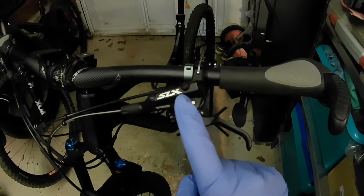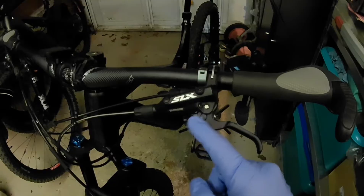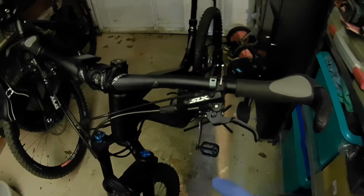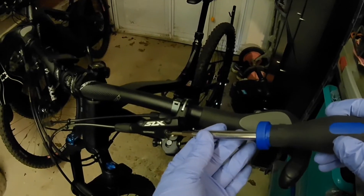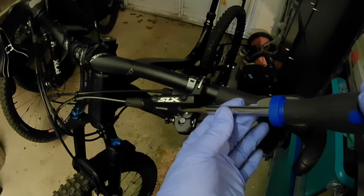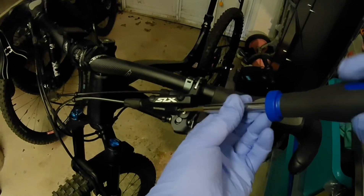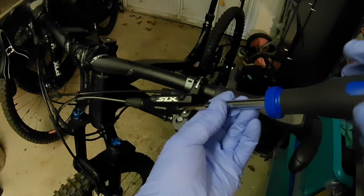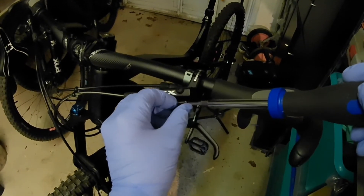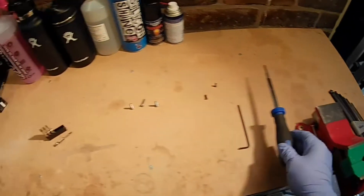This is what they look like when you buy a set of Shimano SLX brakes. All we're going to do is use our U-bit and our hexagon screwdriver to unscrew that. It's not particularly tight when you do this — it's actually really, really easy, there's no resistance, it just unscrews incredibly easily. These cap screws are about 11 or 12 millimeters long so you don't have to screw out very far either.